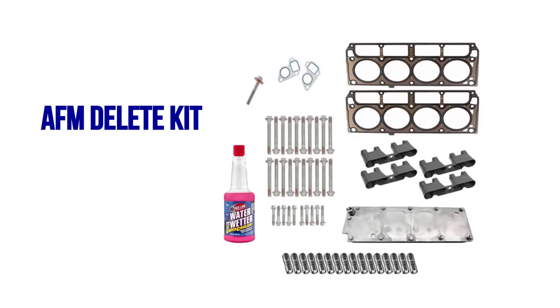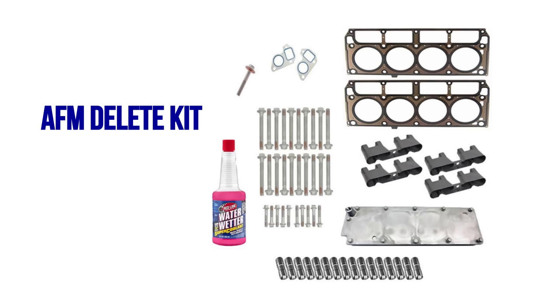What if your lifters, rockers, or cam are already damaged? The delete kit simply replaces the AFM components with standard parts. When installing an AFM delete kit, you must upgrade to a non-AFM cam because the cam lobes on the four AFM cylinders are ground differently — the engine will have 25 less pounds of cranking compression in those four cylinders, which can result in a misfire code. Now's a good time to install that big cam you've always wanted. Engines with AFM also use a high-volume oil pump; when you eliminate the AFM system, the extra oil is no longer needed. Excess oil will be pushed out of the pressure relief valve and spray on the bottom of the cylinder walls, causing burning, especially in high-RPM engines. It's recommended that you plug the pressure relief valve in the oil pan with an M14 x 1.5mm pipe plug, and switch out to a standard volume oil pump.